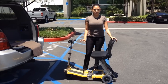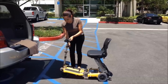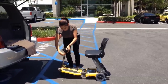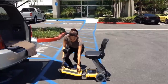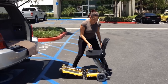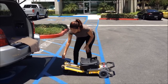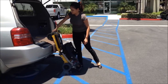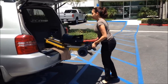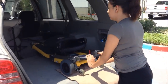The second method is known as flat position. Telescope the tiller down by unclasping the clamps. Pull the trigger a full 90 degrees, lower to the floorboard and secure. Drop the seat while holding the backrest. Raise the front end and rest against the trunk, then lift from the back bumper and wheel into the trunk. This method is suggested for smaller vehicles with limited trunk space.